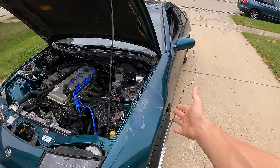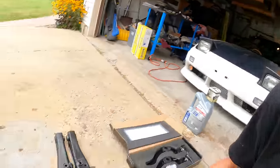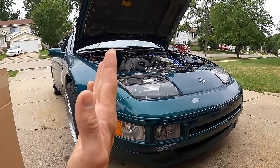I did this conversion for better steering geometry for drifting. It's not that the stock Z suspension was bad in any way, it was just not going to serve the purpose that I wanted to use the car for. And that is why I have these spare control arms. I mentioned in the last video I wanted to extend a pair of control arms to correct that positive camber,